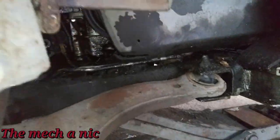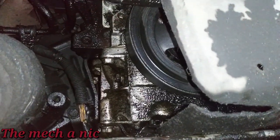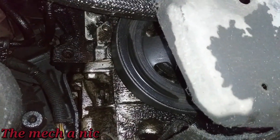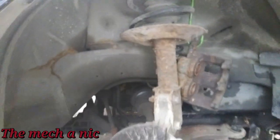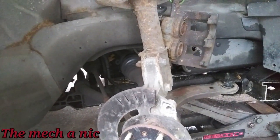I haven't really confirmed it's the water pump, but I think it is going to be that — look at the side of the block here, you can see where it's pretty wet and there's a trail going all the way down over the metal. It looks like the coolant is working its way down the engine, cleaning a path as it goes. I'm pretty sure it's going to end up being a water pump, and in that case we're going to get one from AutoZone just for warranty purposes.